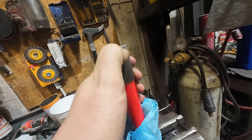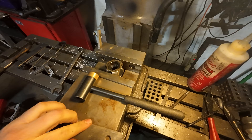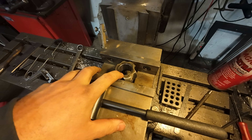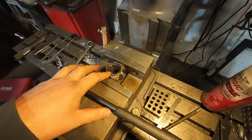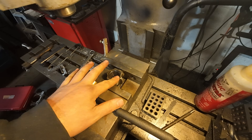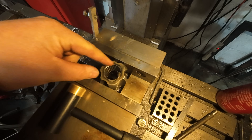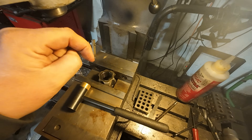The other side axle is grooved and cut — that's ready. Now I'm onto counter-boring the CV stars. I only bought two pre-counter-bored and need to do two myself. With how hard this material is I'm a little worried — it's hard to grip in a chuck because of its weird shape, so I think holding it in a vise and boring it with the mill is the better approach.